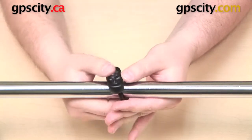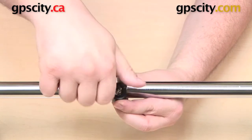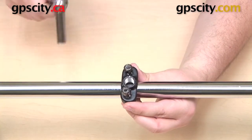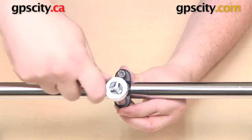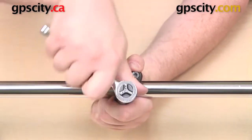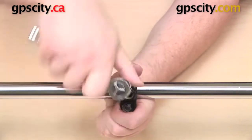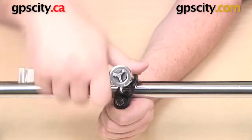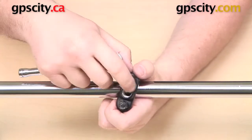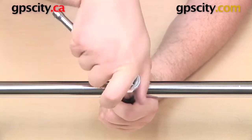Now I can get the top of the U-bolt base down onto the bottom, and I can take each one of the two nuts and get those threaded onto the ends of the bolts. I'm just going to start that by hand, and once those are on there a little bit, I can take my socket wrench and get those tightened one at a time. You want to go back and forth — don't tighten up one side all the way and then go back to the other. If you do that, your mount is going to be installed very crooked. Make sure you're alternating back and forth between each side of the U-bolt, tightening up one side and then the other. Make sure it's positioned where you want it, then continue tightening all the way.